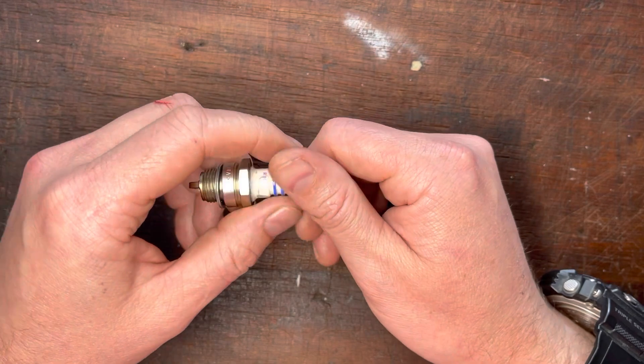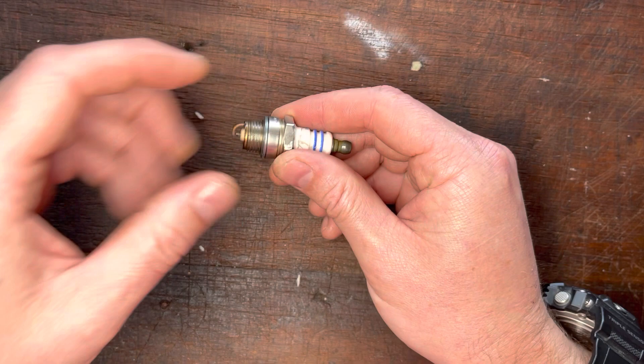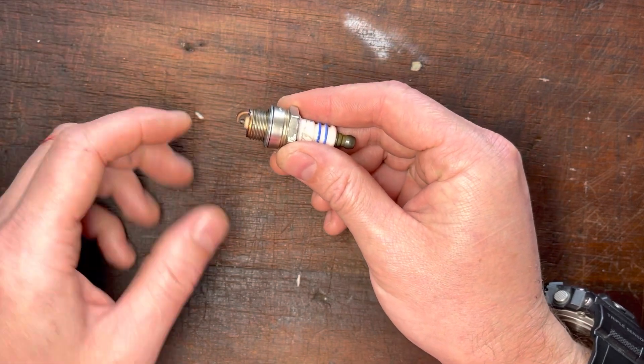Those are the sorts of things that are going to tell you so much more about the engine. It's worth learning for the simple fact that it tells you everything you need to know in real-time. The best way you can tune an engine is by hearing and feeling it. The soot ring gives you a very small, sharp window into how your engine is running — but for jetting, not for other aspects like heat range and detonation, the plug colour tells you nothing. So ignore it — that's my advice.